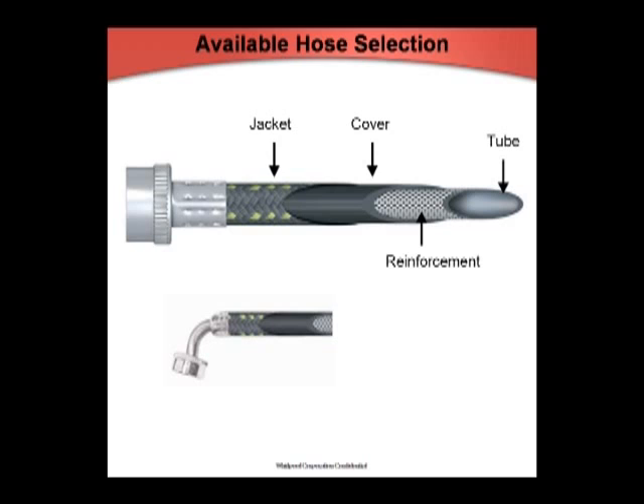Six-foot nylon braided with 90-degree elbow: these hoses have a space-saving 90-degree elbow, hypro-blue steel anti-corrosive couplings, a nylon braided protective layer, pre-installed high-quality EPDM washers, a large diameter for maximum water flow, and a 1,700 PSI burst strength. All Whirlpool hoses exceed IAPMO, CSA, ANSI, IEC 61770, and RMA standards, and are designed for use with both hot and cold water inlet. They're better than stainless steel and will not conduct electricity. It's recommended to replace inlet hoses after five years of use to reduce the risk of hose failure.